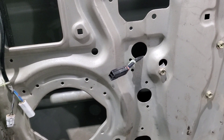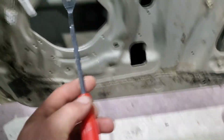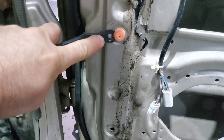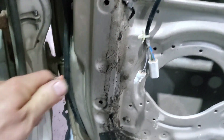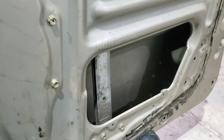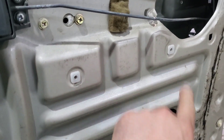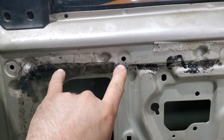I'm going to show you how you pull off a door panel even though I don't have one on right now. You will need this trim removal tool — it gets in here and you can get underneath the back side of the door panel, underneath these clips, and it will just pop them right out. You work your way around; you might be able to pull with your hand as you go. First you'll have to have your door handle removed — that will be Phillips screws front and back. The Pathfinders may actually have another one up here somewhere.